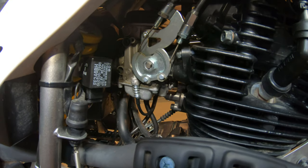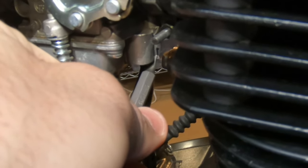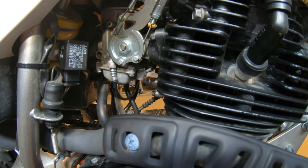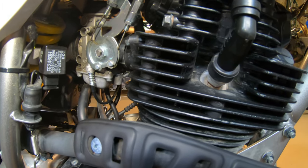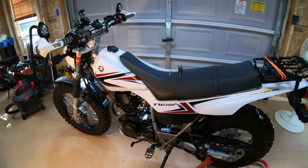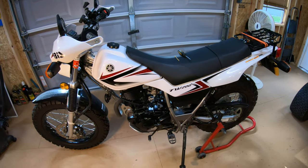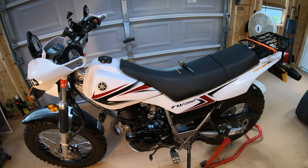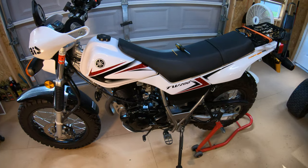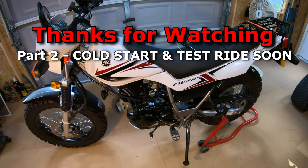That's how you do it. You button everything up and it's real easy — I should have done it a long time ago. That's the screw right there. You get a richer air/fuel mixture and that allows it to start easier, not be so cold-blooded, and it might even have a little more power. I recommend doing it especially if your bike is cold-blooded, needs a lot of choke to start, or takes a long time to warm up. From the factory they're all a little different — people report anywhere from a quarter turn to one and a quarter turns out.